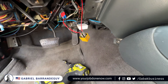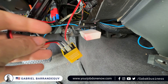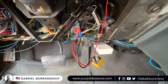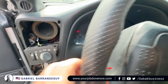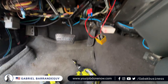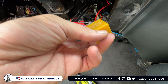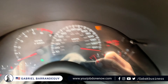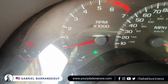I was able to hook everything up. You have the two main connections and the third leg going to the chassis for ground. I hooked it up exactly as described — now I'll show you. I put the blinkers on, and as you can see it works and you can hear the clicking noise. The potentiometer lets you change the blinking speed — from very fast to slower.